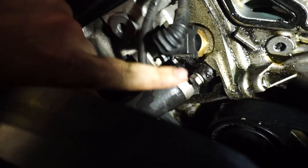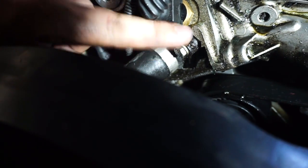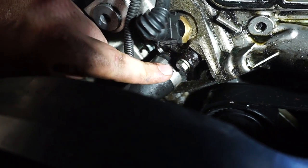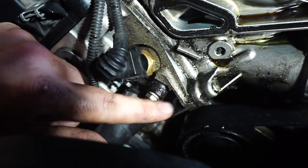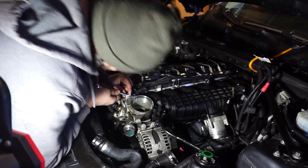Okay, this radiator hose right here, a lot of people take off to get to this bolt here, and these ones constantly break, and then you have to buy an aluminum billet one. I don't think it's too expensive, but if you're gonna take this off, you should probably just get that. But I believe that we take it off without removing this. Yeah. It's a little more difficult, but you use like one swivel, and it comes right off. Pretty sure that's how I did it.